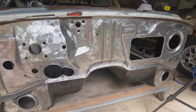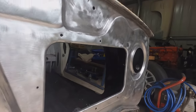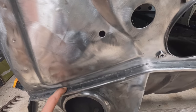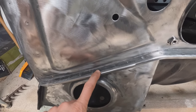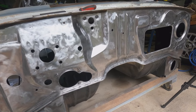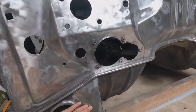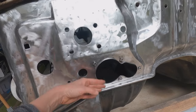I have nearly finished grinding the firewall, just doing around all the seams. We've got most of the bottom seam done, a little over half the top seam done, but about here is where it starts getting a little bit more difficult with a little bit of extra surface rust. In a lot of places it's really thick, but when I get right down into the layers, I'm sure I can see something that looks like Palais White. I have no idea if the firewalls came out of the factory in the body colour or if they were painted black or if there was a choice. It looks like some kind of white underneath the black and then underneath the white, I'm pretty sure I'm seeing the red oxide primer. I'll probably save these bits — everything under the seam — for when I flip her on the back, because I think that seam's going to do a good job of stopping any runoff going inside the cab.